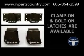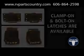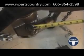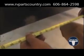Next, install the signature series rotating latches. In this video, clamp-on rotating latches will be used. Bolt-on latches are also available. Measure 29 inches back from the center of the ball coupler or the pivot pin and mark this point on the trailer tongue framework. Mark on both sides.